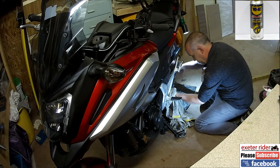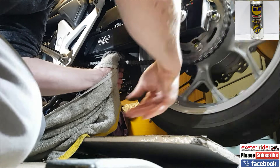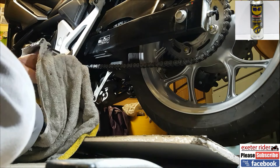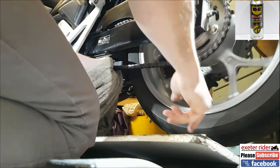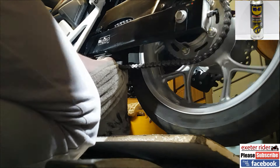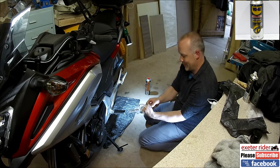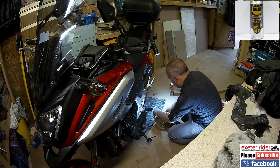Now I've got a clean towel and I'm spinning the chain, getting all that grease off — all that old chain cleaner. What we don't want is any chain cleaner left on the chain when I put the new wax oil on. I keep spinning it and you've got to get all of that chain cleaner off. Get the gloves on ready for oiling.